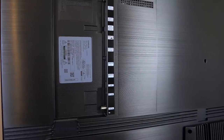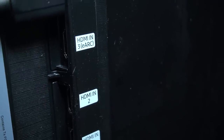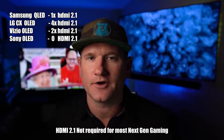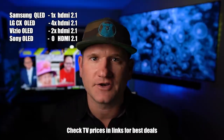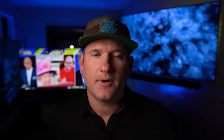The TV has four HDMI ports: three HDMI 2.0 and one HDMI 2.1 for gaming at 4K at 120Hz, along with game mode and VRR with FreeSync. One of the HDMI 2.0 ports is eARC-compatible, so you can connect a soundbar and get Dolby Atmos. At this price point it would be nice to have all HDMI 2.1 for future-proofing, but one port is better than none.